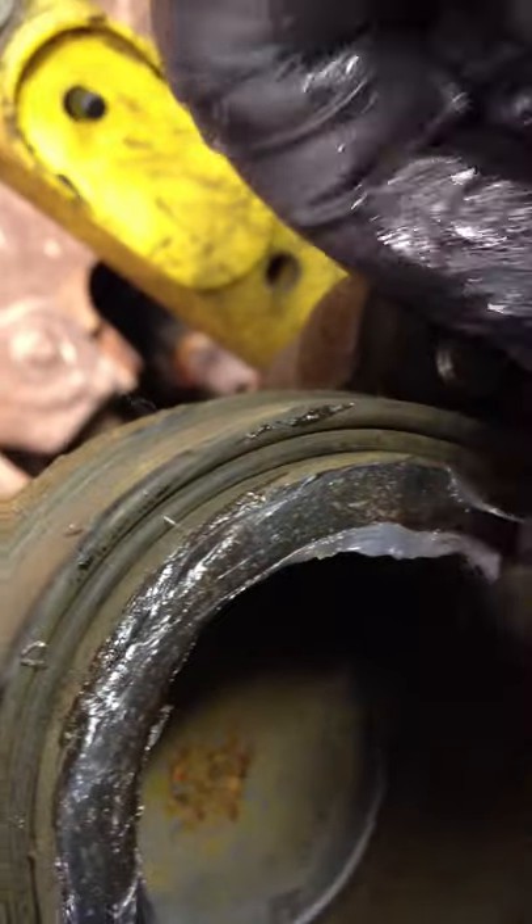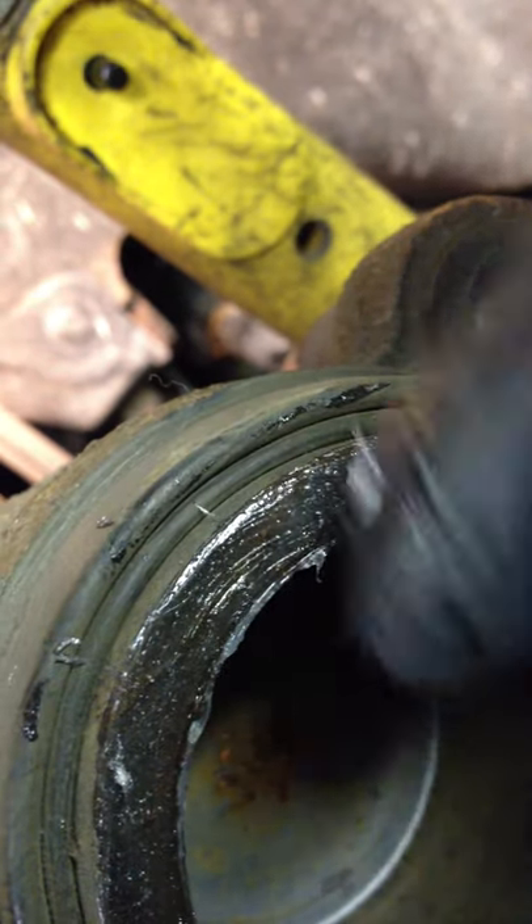Put a decently thick layer all the way around — you can see how thick it is. This area can be a little sloppier; that's the area of the caliper on the inside. There's the piston — here are the ears on the other side. You can get a little thicker and sloppier here because it's on the back side of the pads. This prevents all those oscillating squeaks and noise — lots of noise gets eliminated with this stuff. Put it on every brake job.